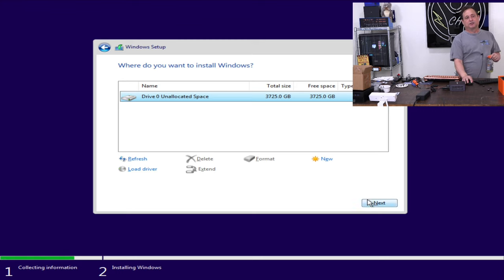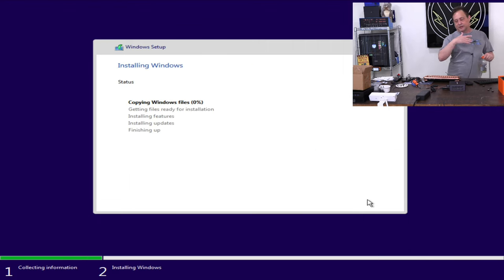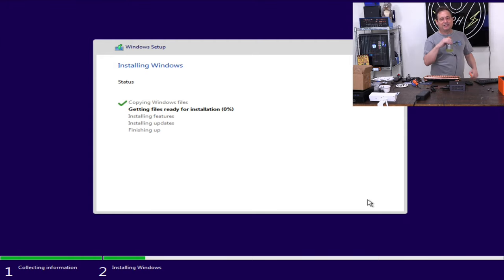And we can continue our Windows 11 install the same way. Everything's the same from this point forward. That wasn't too bad. I just didn't realize I had to manually select the drivers. I thought pointing it to the directory would search, but that's when you're in Windows loading drivers in your Device Manager, where you only need to point it to the master parent directory. But here during setup, you have to be quite precise.